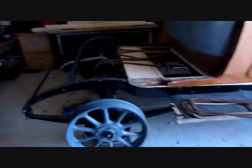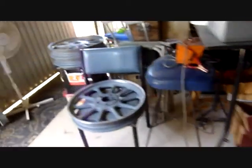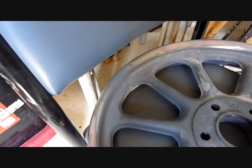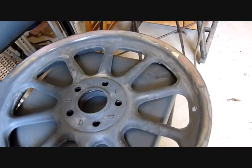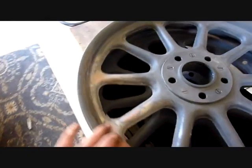We've also got the wheels ready to be painted. This is one of them — the 19-inch wheels. We've bogged up all the dents and what we had to. We checked them and they're actually pretty well round, which is a good thing considering they're wheels. You can see all the dents along here; this one was the most dented. They're all sandblasted and coated in a primer that can be done as acrylic or two-pack. We're doing acrylic black, so they're all done, ready to go.